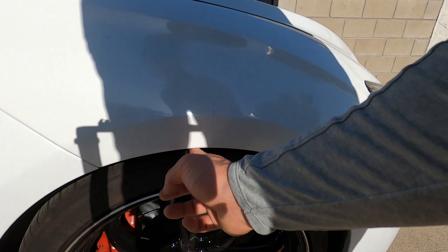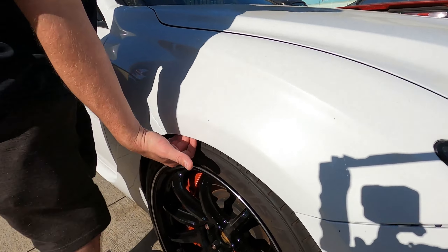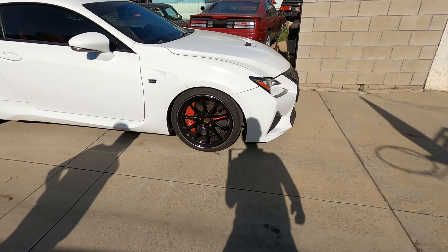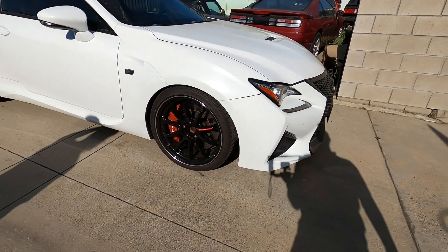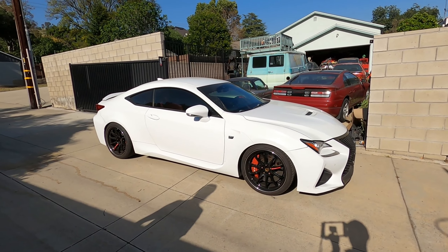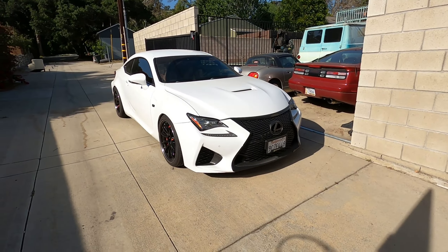Something to note: on the front there are a couple of tabs on the fender that just need to be folded up slightly if you're running aggressive fitting wheels. These wheels are 9.5-inch wide, +30 offset, with 255/35/19 tires on the front — which is actually the proper size. Caesar could even bump up to a 265 if he wanted, since the 9.5 isn't super aggressive in the front and there's a bit of extra room for tire. The ride height is really solid.